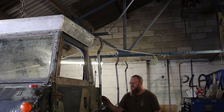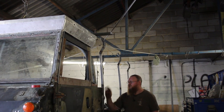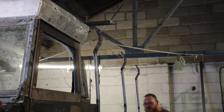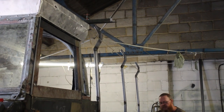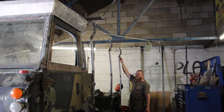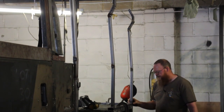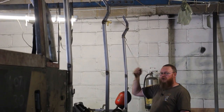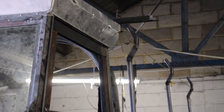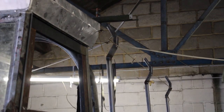I call that tumble home — which comes from a naval term for old warships, sailing men of war. So it comes in here and then, as you can see, it's cranked out. To make sure they're all running in line with each other, I made a frame to sit them on. I used the rope from the main swage line as my reference at the top of the cab, and then everyone was matched for positioning in and out from that line once I'd squared it up. And then I cut the height, which told me exactly where to cut so I could put these tops on.